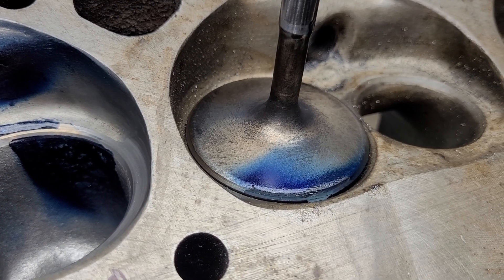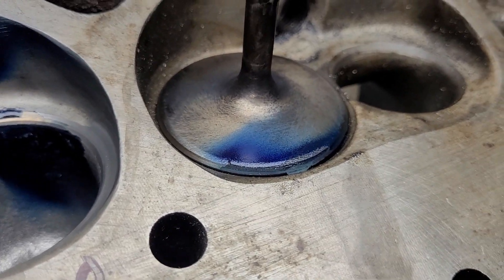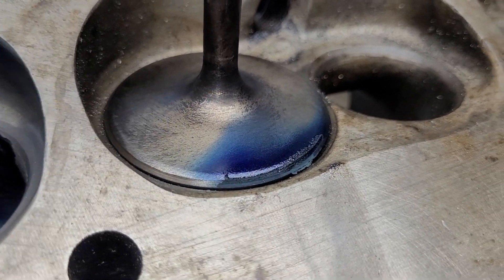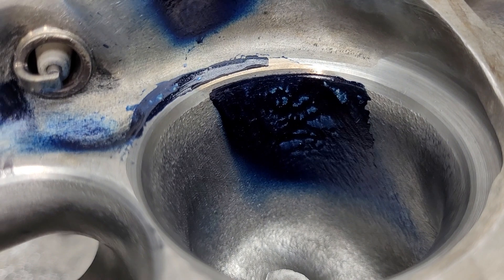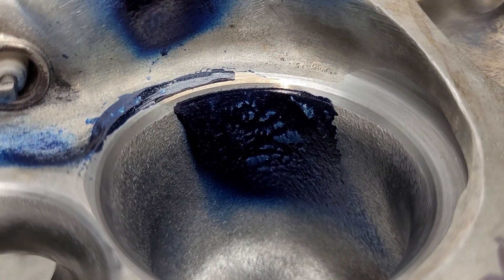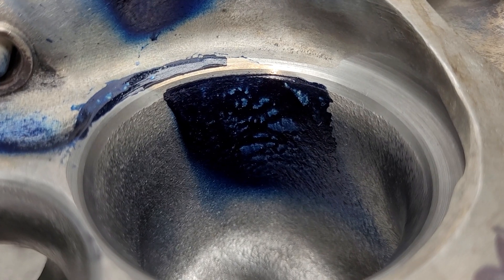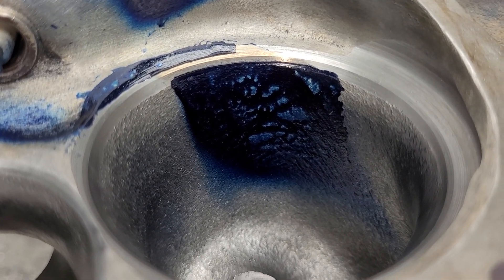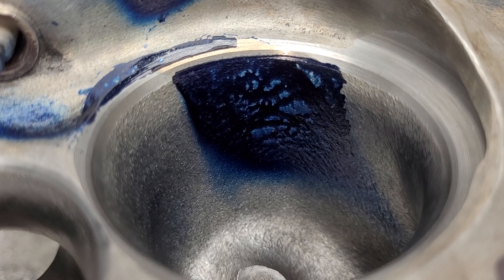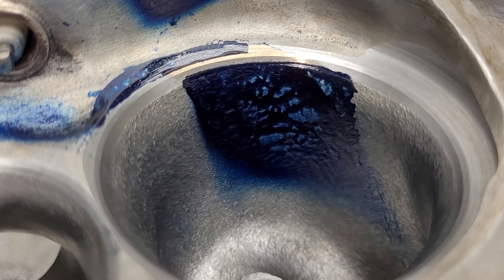We are much noticeably better on the valve itself now — way wider pattern in the bowl, way wider pattern overall. And the reason for that is I had to change the height of the roof a little bit due to the air speeds on the roof, and it obviously likes that.